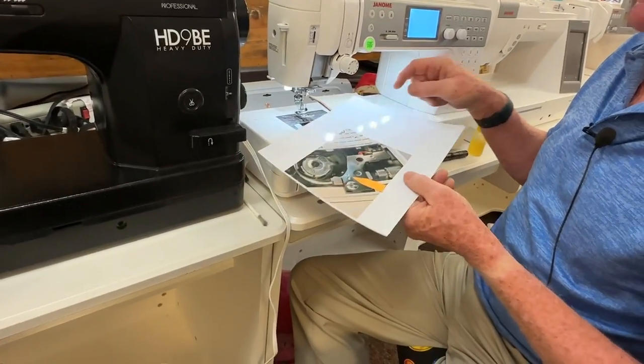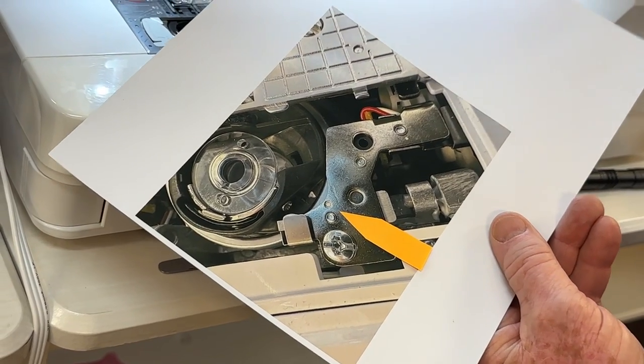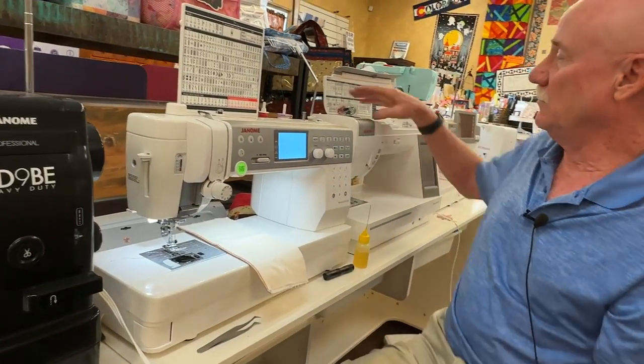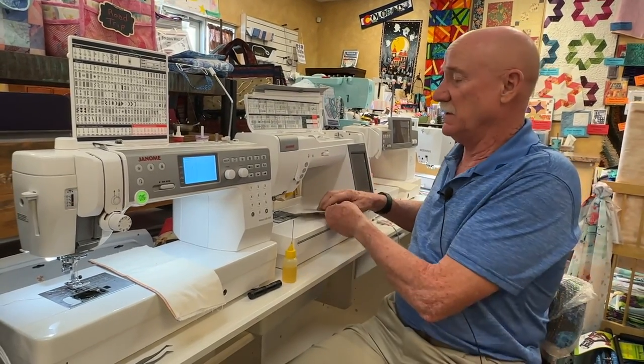Here is a bobbin basket from a Baby Lock — they have a dot and an arrow, a triangle, that needs to be lined up when you put it in. Now it's important to oil that too. If you keep this clean and oiled, and on a lot of Janome's the head opens up over here, and you can dust it out and even oil in there. They give you a lot of opportunities to keep it running smooth and quiet. This has been SoTech Jeff — I hope this helps you out on your drop-in bobbin cleaning and oiling. You can get my products at Bernina-Jeff.MyShopify.com, or call the shop at 970-256-1293, or email me at jpvlefty@aol.com. Thanks very much and thanks for watching.